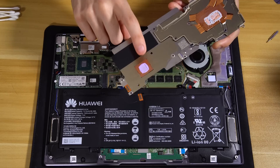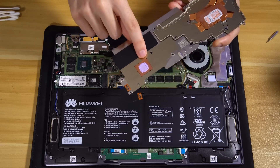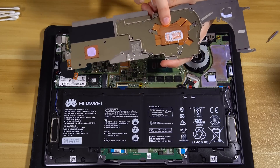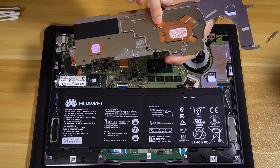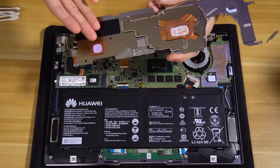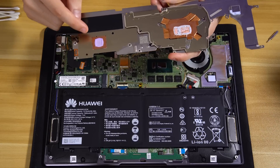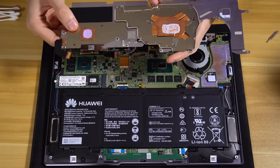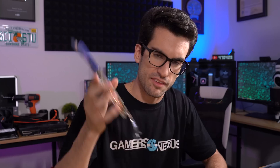I'm going to swap out the thermal pad anyway because the GPU still gets pretty hot under full load. Both the CPU and GPU still have a copper slug, and these are tied directly to the copper pipes running around the fan. We want that contact, and copper will be okay for at least a few months when we use liquid metal.